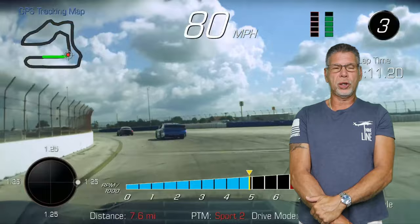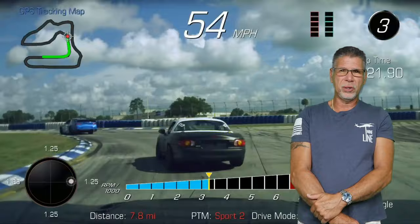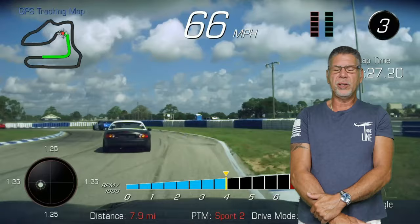I went 19s because I didn't want to go to 18s, even though you have more options with 18s by going to slicks. But I don't want to run slicks because I have no room — I drive my car to the track, and I'm not driving to the track on slicks. I really have no room to put four tires in.